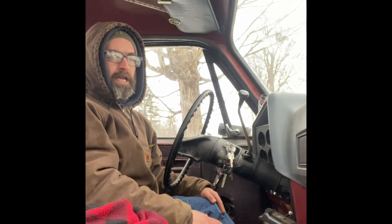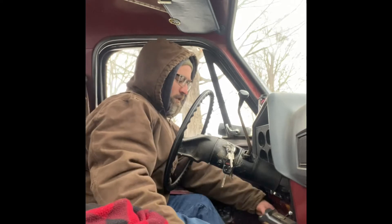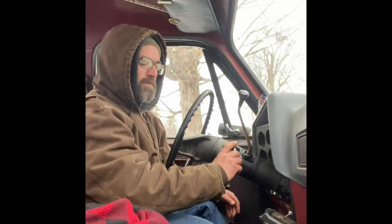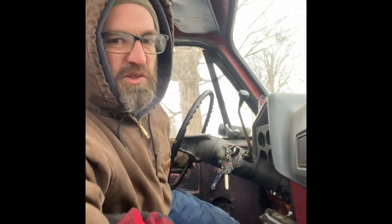1980 Chevy K20 with a 292 straight six, in case anybody's curious. Pretty simple process. You got your throttle down here — kick it to the floor. Pull out your manual choke with the pedal to the floor. Release the pedal. Turn that fan off, blowing around cold air. Give it a twist, you're going to hear it burp. It fired right up tight. Now, once you hear it burp, you just kind of push the choke cable in a little bit to get some air. Let's go outside and see how it sounds.